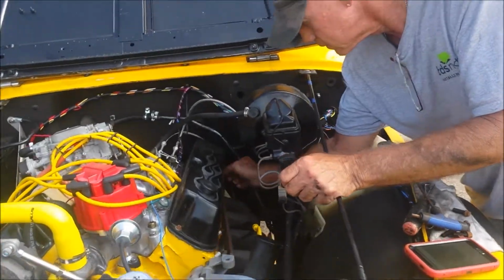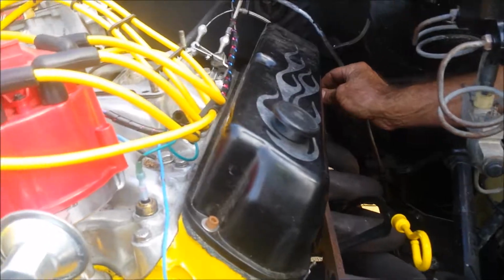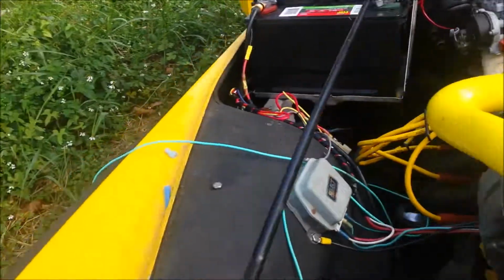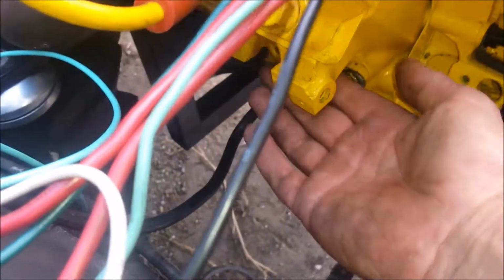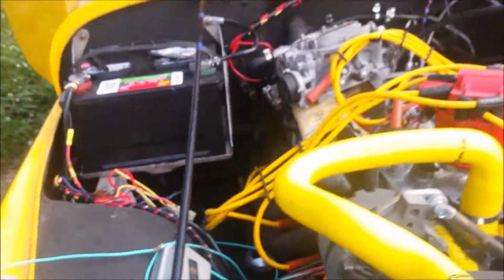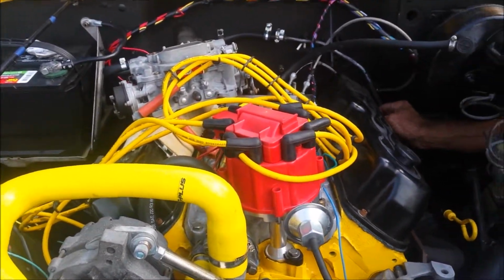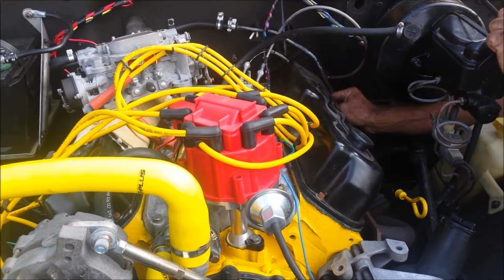So now we're over here on the Jeep. Rob has just finished, you see the headers off, he's putting the valve cover back on. He just got done double checking all of the head bolts because we found this head bolt loose by a third of a turn before it got to 70, and the engine was leaking out of the head gasket right here below that bolt. So we've got our fingers crossed that that's going to resolve the issue here, and we'll probably be trying to start this back up either this evening, which I'm not going to have time for, so we might go for it again tomorrow and try to set the timing and look for that leak.